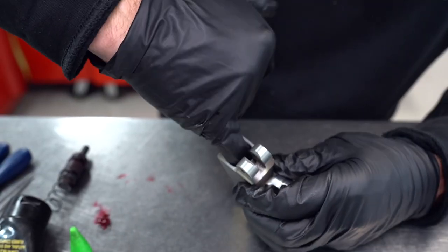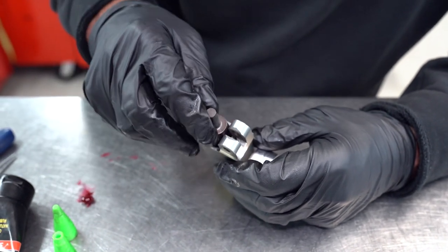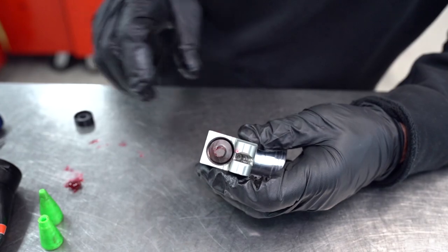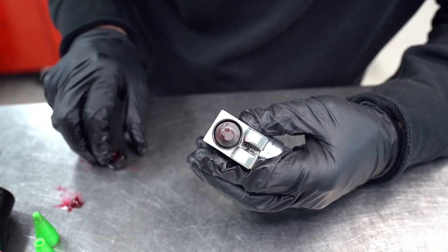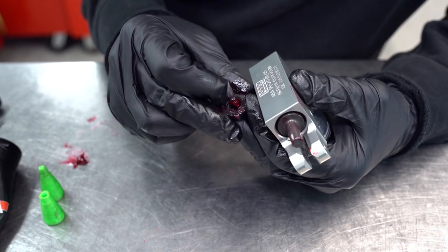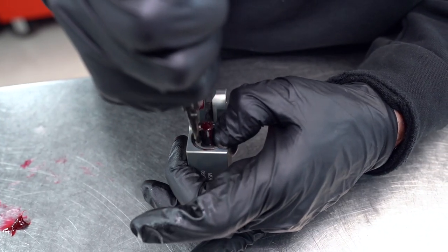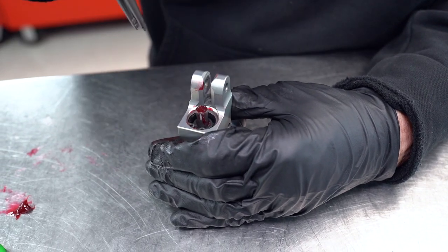Reinstall your spring. Put a little bit of lube down in the cylinder so that when we reinstall the piston it all slides together perfectly. Put some grease on the shaft, and you can also put some grease on the inside of the seal here so if any dirt or muddy water comes through it gets caught by the grease. Then using your circlip pliers, push the whole assembly into its final position and lock it in with the circlip.